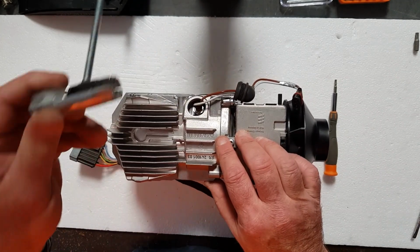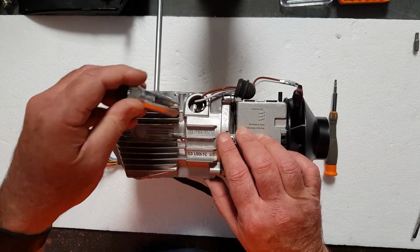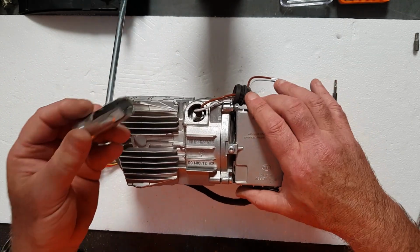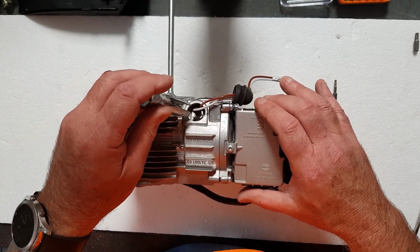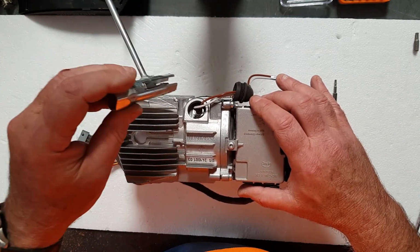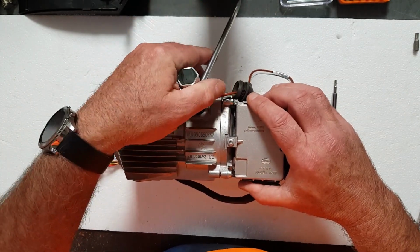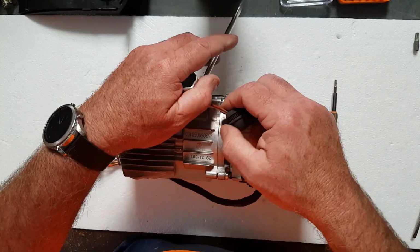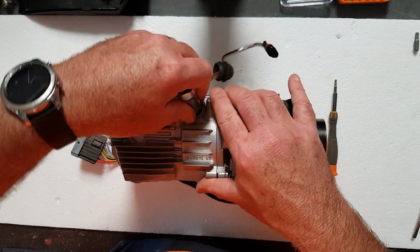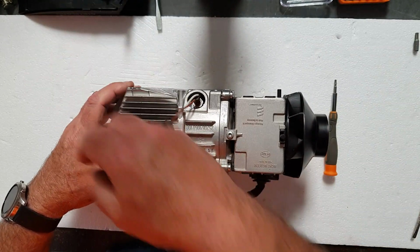The heater itself, when you buy it, is supposed to come with a socket which has a slotted side on it to go over the wires. I maintain I didn't get one when I bought my heater, but nonetheless, we'll continue on. I made one out of a chainsaw spark plug remover. There shouldn't be a lot of pressure on here. Crack that nut, take the socket off, and gently take that glow plug out.